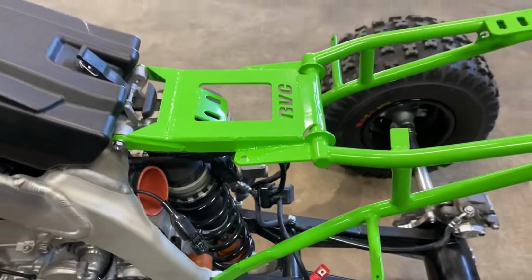So here's the intake for this build. We have this pre-drilled and threaded for the sensor. So we're gonna take the factory sensor and insert that into here. It does have an O-ring on it, but we always put a little bit of yellow bond on there just for extra insurance. And I'm gonna throw some red Loctite on this hold down screw.